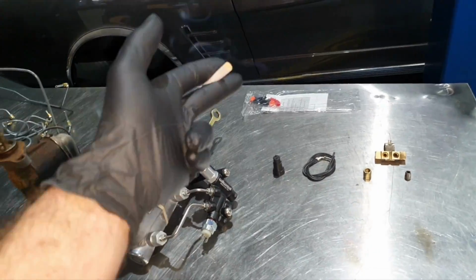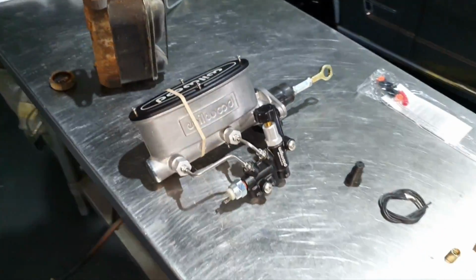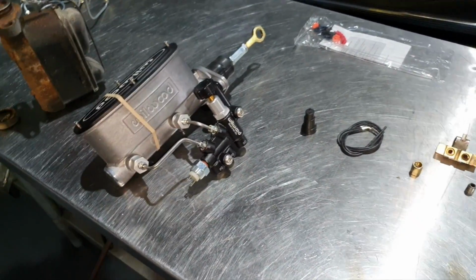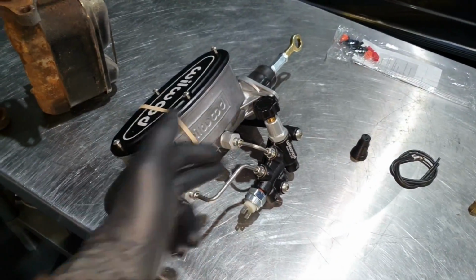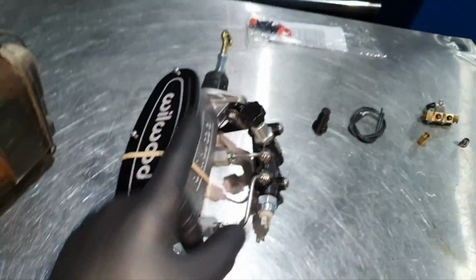First I check the stroke from both of them. I adjust the bracket, the shaft that comes out, this one, bolt in place. This is to distribute the pressure, all right, front and rear. It's been already torqued down here. From the other side, I haven't torqued it down to bleed it first, to bleed the piston first.